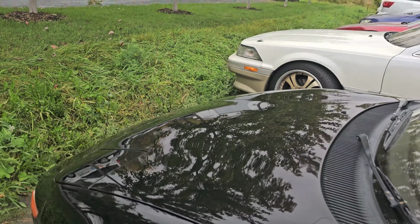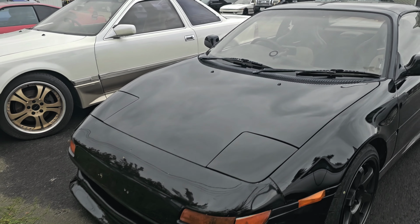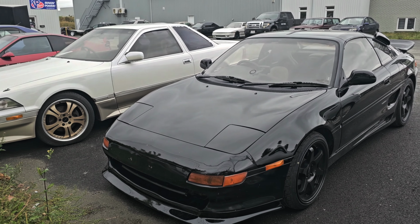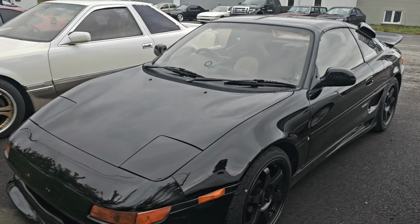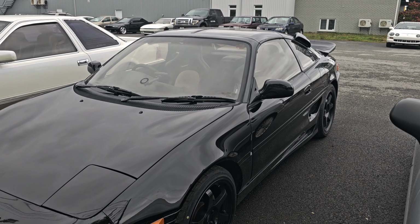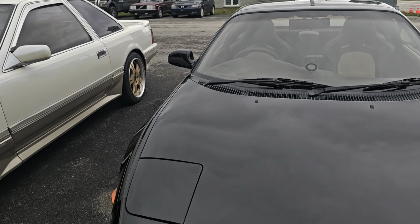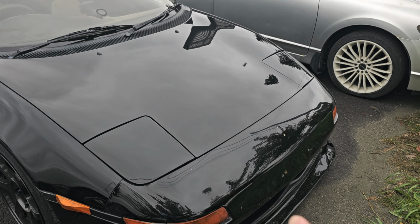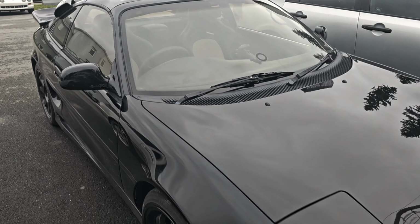Even if it's a Toyota, no matter what brand you truly believe is truly reliable, any older vehicle is gonna cause some problems. So it shouldn't be the alternator, as they already took that apart and changed bearings inside. We got the trim glued up, peeled away the excess 3M double-sided tape from that trim bar. So we've glued it in. Hopefully we find a little missing piece there. But still some work to be done on this. Also, the headlights aren't popping up because a nice little chipmunk ate through the wiring. So we're gonna get the wiring replaced on that